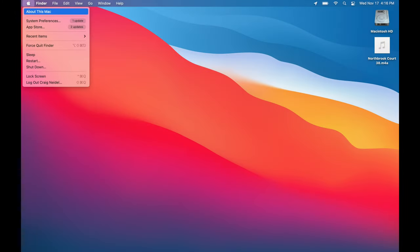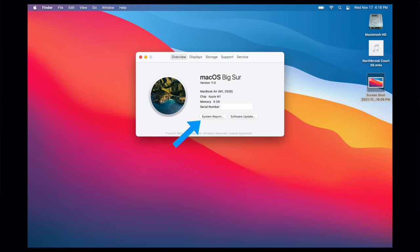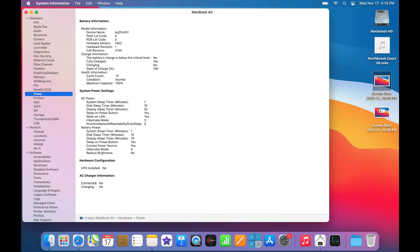You can check your cycle count by going to the Apple icon in the upper left-hand corner, then About This Mac. In the middle of the screen, you'll see System Report — click that, and on the left-hand side, click on Power. You'll see your cycle count there. A cycle count is basically whenever you charge equal to 100% total charge. For example, going from 100% to zero and back is one cycle. Or going from 80% to 30% twice and charging each time — that's two times 50%, which equals one cycle count. You want to keep that cycle count down for resale value.